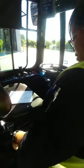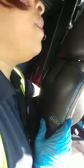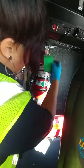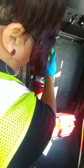Now I'm going to do my driver's area. We have the fire suppression system up here — it's indicating that it's working with a green light. I have my fire suppression override system — making sure it has a valid inspection sticker and the pin is intact. My fire extinguisher — securely mounted, valid inspection sticker, pin present, and the yellow arrow is in the green indicating my extinguisher is full.